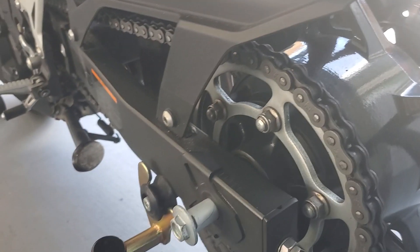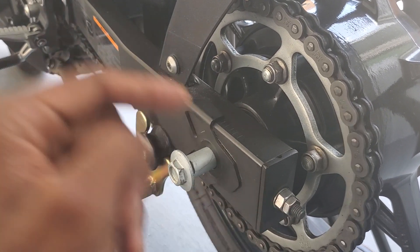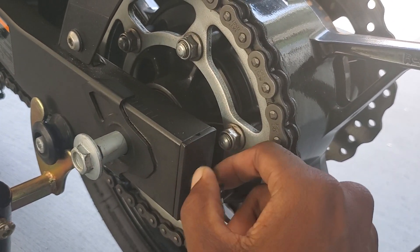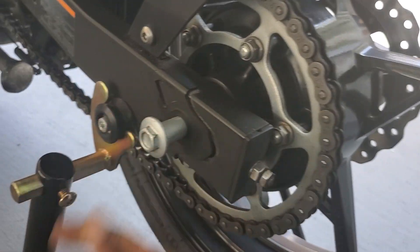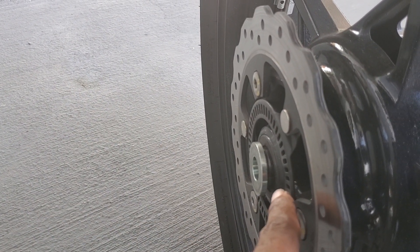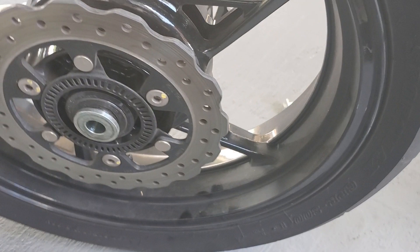Correction — this one is a 14 and this one is a 12. What I normally do is loosen the front one first, break that one loose just a little bit, not too much, then the second one — just pretty much slide — and then you just push the tire forward. Do the other side the same way; the second one is usually always really loose. Now that I've got it off, I just rolled the wheel away from the bike and it's already starting to become loose — it's going to fall out.